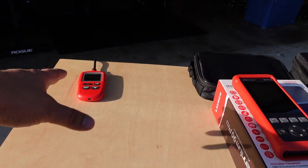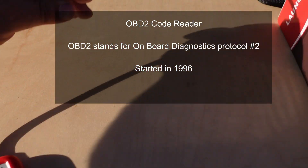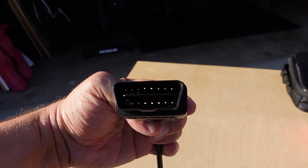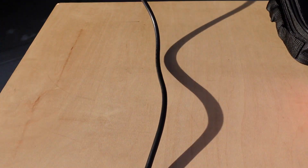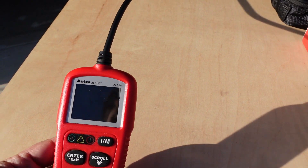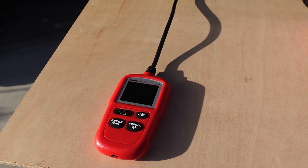Let's start with what is an OBD2 reader. This is an OBD2 reader — they run from $20 to $50. They're pretty cool for any vehicle that's 1996 and newer. For North America, these will just plug right in and give you a generic OBD2 code which you can look up to try to figure out what it could be. You're kind of taking a shot in the dark because you don't know the exact manufacturer's side of the code.